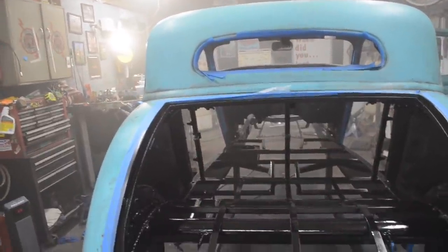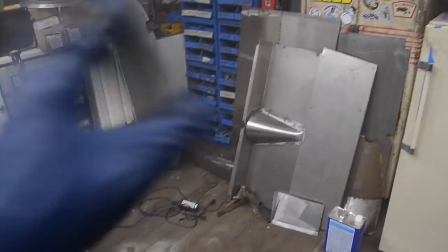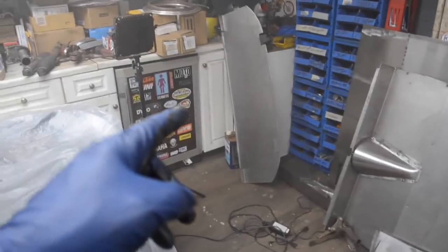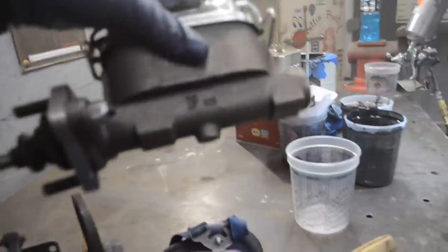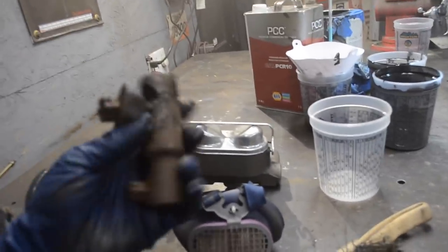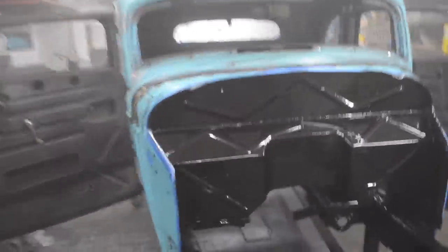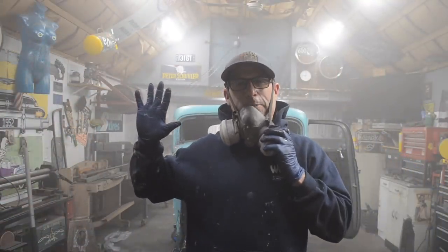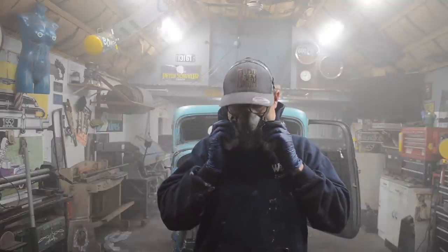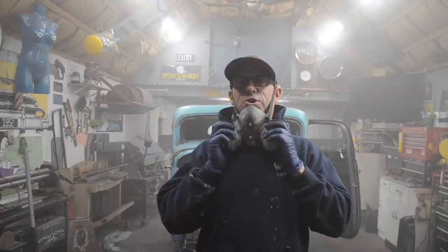After it's dry, I can cover the car and then get to work on all the floor panels, package tray, and everything for the trunk and all that other stuff. While I'm doing that, I'll do these pieces — I'll start sandblasting, break this down, get that painted. Stuff like this can get pulled apart and sandblasted. Just really start going through all the little bits and pieces and start getting everything in sealer. That's it. Thanks everyone — I appreciate you guys' support and following along. I'll see you soon. Take care.